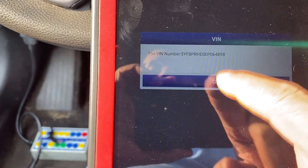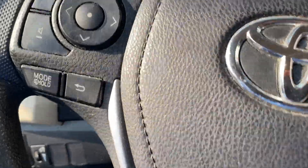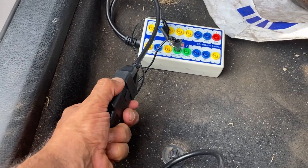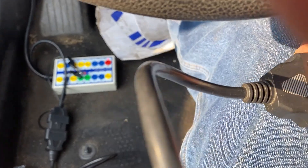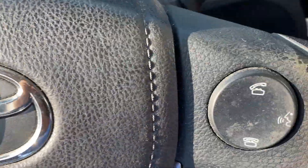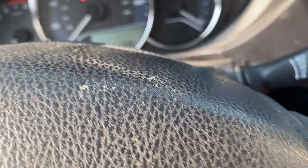If you want to write down the VIN number, you can hit Write and it will write right away. Now I'm going to take my scan tool out, disconnect it from the VCI. We're going to turn the ignition off, and then jump between pins 4 and 13. Then turn the ignition on — you should have a Christmas tree of warning lights starting on the dash.